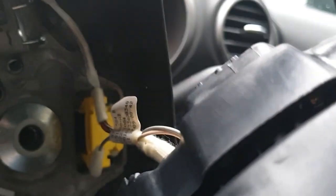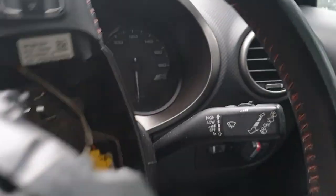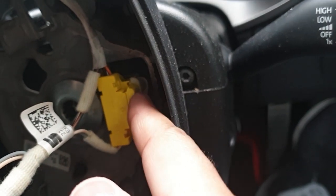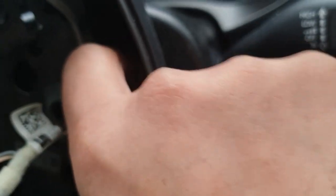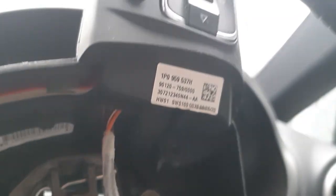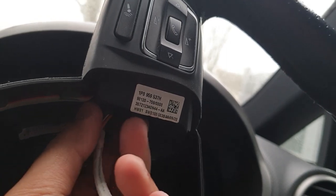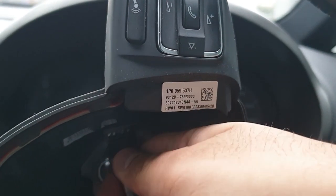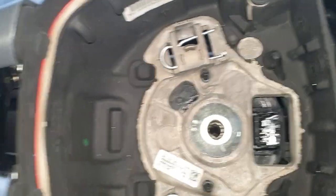Remove this and there's one plug over here. Let me put this airbag unit to the other side. You can see this white clip — you basically just need to pull that as you're pulling the plug, pulling on both sides. Just reach in and grab it — there should be two clips either side. Pull it and wiggle it a little bit.